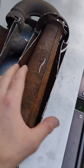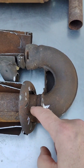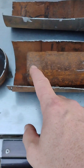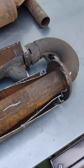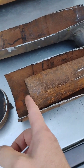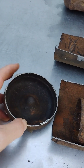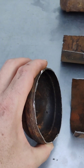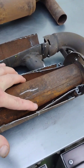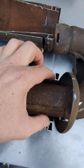This is pretty cool. This right here is where you see the header connecting here, comes around, and goes into the front of the muffler like you would see right there. And then we got what kind of looks like a megaphone — you know, when guys are in those sound contests to see how loud they can get their snowmobile to be? We got ourselves a little mini megaphone right here. But it stops dead right there, and the exhaust would hit into the face of this rounded-out pointed part of the muffler.